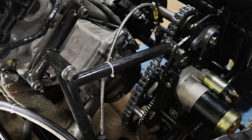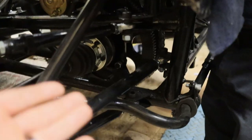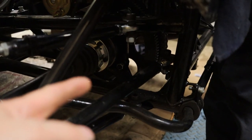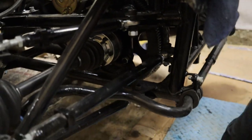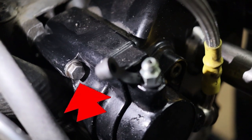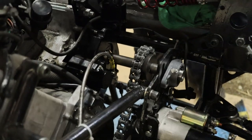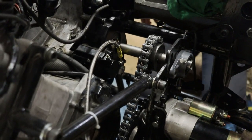The engine was engaged and Dave was pushing the pedal, sending oil to the slave cylinder. I was trying to turn the sprocket by hand, but nothing moved. I was just too weak or something, I don't know. What happened is that we sent too much oil to the slave cylinder and we broke the casing, right there. It's been a long day, but we want to get this thing done, and we just don't want to finish the day with a failure.